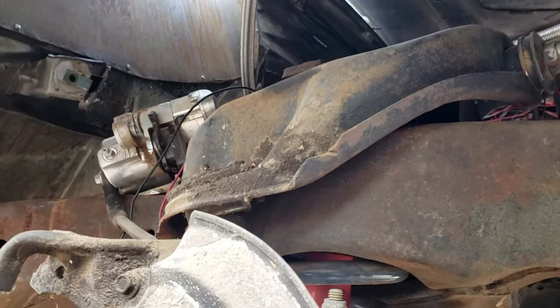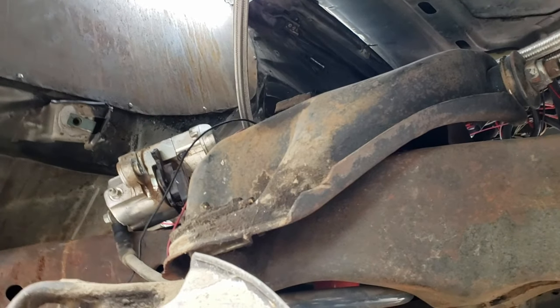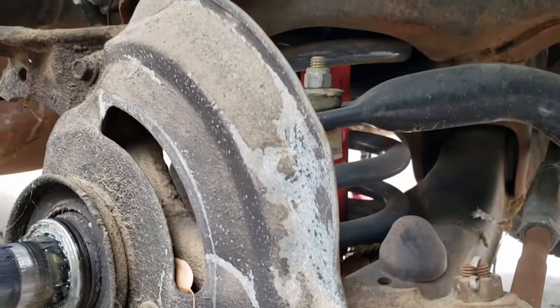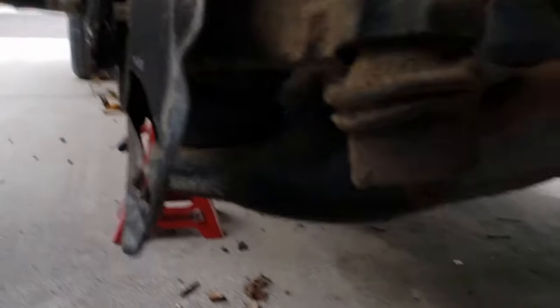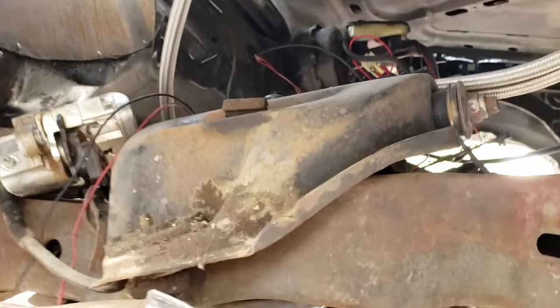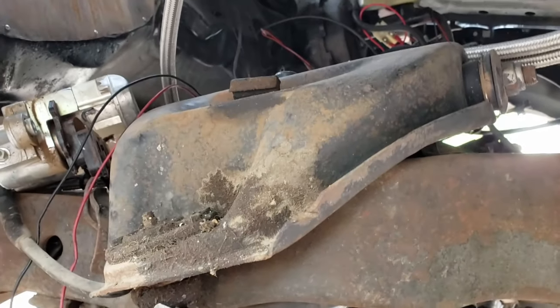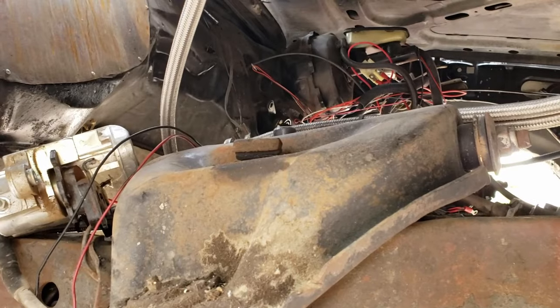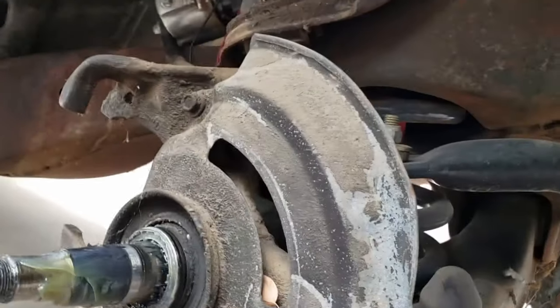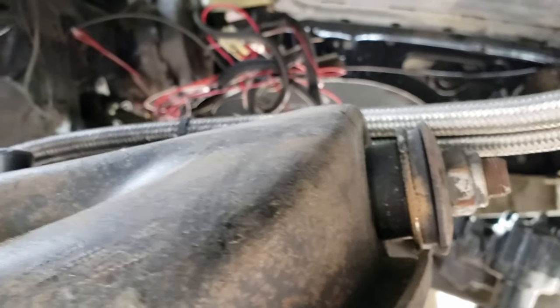Before the car is running and going down the track, hopefully I will be replacing the upper and lower control arms. The reason we didn't do it originally was because at the time no one made aftermarket uppers - the uppers are weirdly shaped. But now everybody makes them and you can get them fairly cheap. We will be completing the aftermarket suspension at some point - the A-arms are literally the only stock suspension components left. We even put brand new polyurethane bushings in the A-arms.